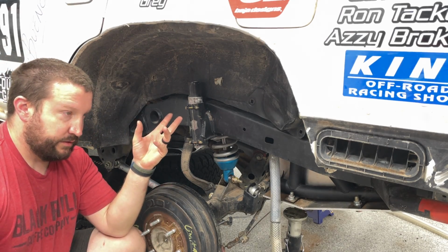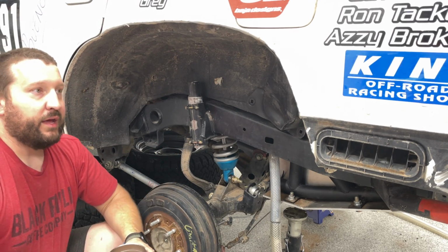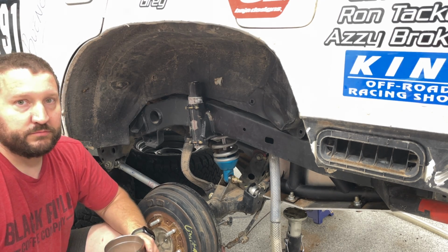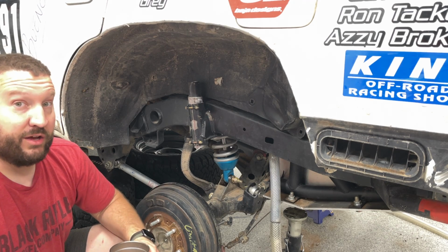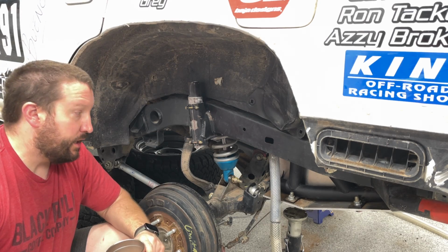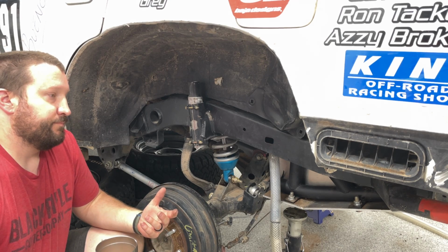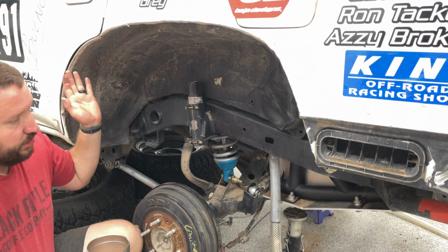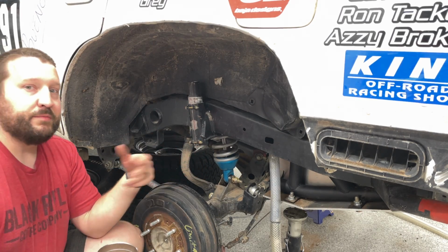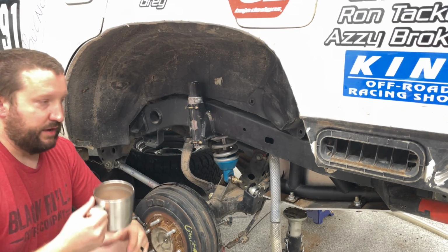But wheelbase, the other thing that we were talking about, the distance between the front wheels and the back wheels, is something that is a sore spot with this truck. It qualifies as a short wheelbase 4x4, as in class 3 of SCORE's race code is for short wheelbase trucks. I'm not required to stay there because I was a sportsman's truck. There's really no reason for me to keep this spot in the truck if I am going to be upgrading the suspension to something much more robust. Something not like this 5-link.